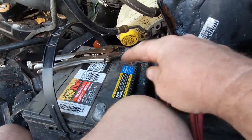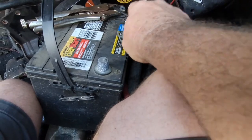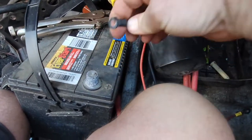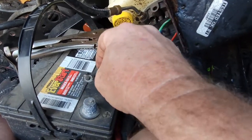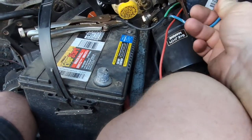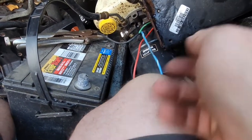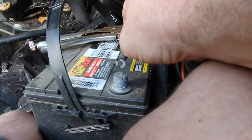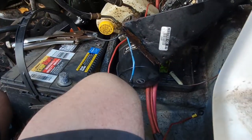What I did was jump the pump real quick to bypass all the solenoids and make sure the pump itself isn't locked up. You do this at your own risk when working with batteries. I've got my black to the negative, the blue which would be one direction — I don't know if it's up or down, anyway just checking it. It was working — I might say this motor is bad because a second ago it was working but it sounded a little rough. I guess I'll be changing the whole pump out. That one's no good.